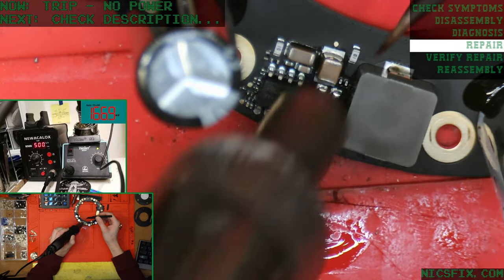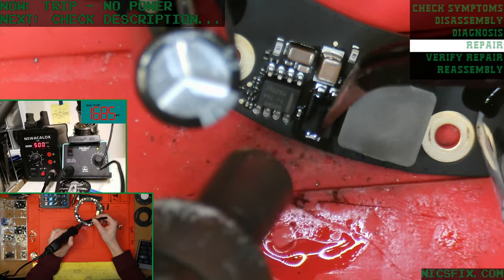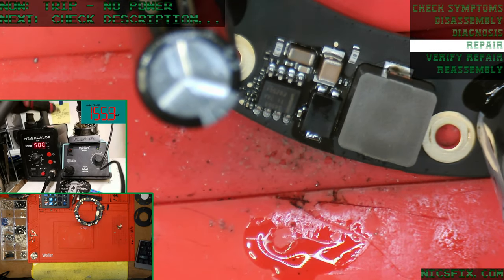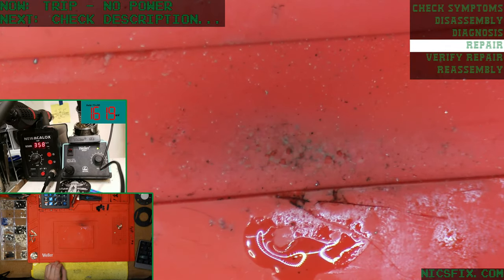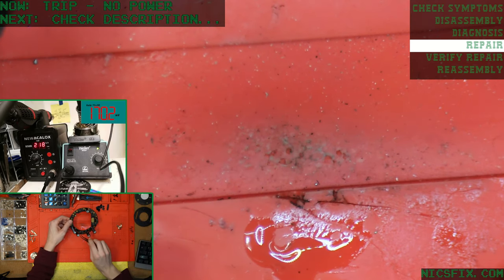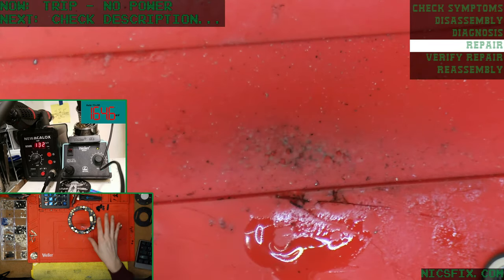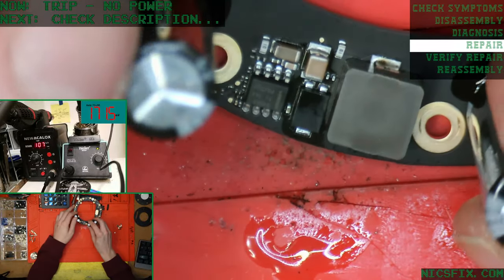No others, and we've seen hundreds of them by now. We keep all of them, just to keep track. Not a single one has broken that rule yet. And we can say that we've had at least 400 come through us by now. At least 400 diodes have been replaced, whether they were working or not. And all of the bad ones were those date codes.